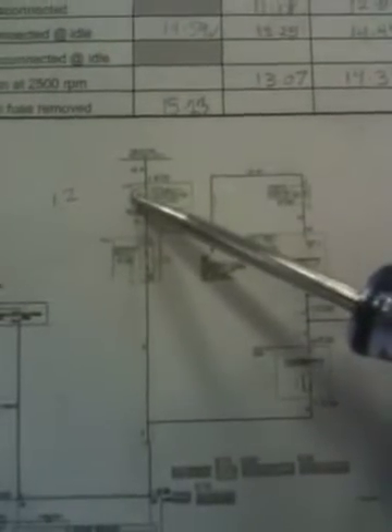Here's what we're going to do. We're going to pull both fuses to leave no power going to our alternator terminal, and we're also going to pull the generator relay. Our generator relay has been removed. Here's the empty cavity of the generator relay.